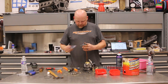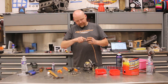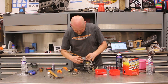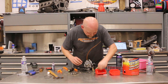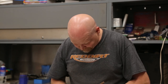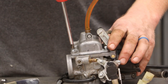I'm going to go ahead and put a little lubrication on the O-ring for the bowl, and then slip this guy up under here. And then we have four new screws for the bowl and we're done. I'm just going to snug them up, four corners criss-cross style, so that we don't crack the bowl.